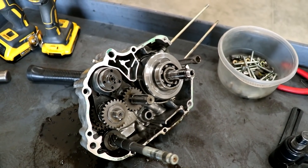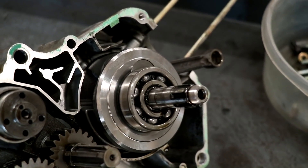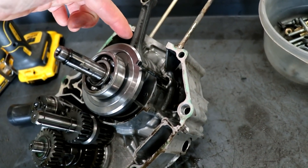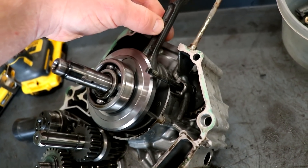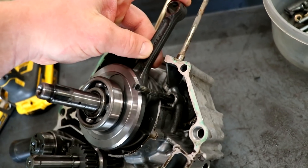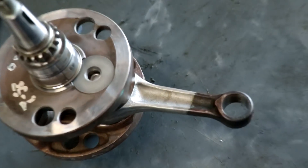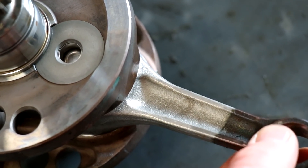This is the guts of a little four-stroke engine. The most essential piece is the crankshaft. Typically when someone says a bike needs a bottom end rebuild, they're referring to the crankshaft needing replacement. Most of the time when a crankshaft goes bad, it's in this bearing right here called the rod bearing. A bad rod bearing is one that has movement up and down — as you pull it up and push it down, you'll feel movement in that bearing. This bearing feels pretty good. In contrast, this is a rod bearing that has gone bad in a CRF 450 crankshaft — as I pull up and down on the rod you'll be able to see and hear the little bit of movement it has. This crank is toast.